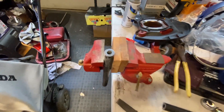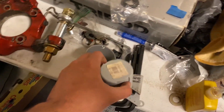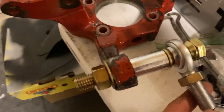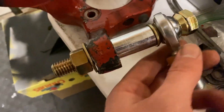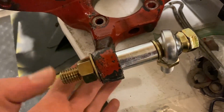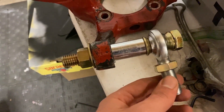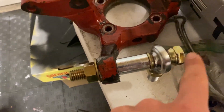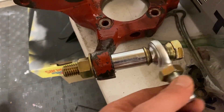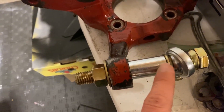I'll get this thing filed down flat and have some tie rod tubes made. Working on this tonight while waiting on parts. This is the knuckle setup - this is the bottom, this is the top. The end link setup is going to be: the 5/8 heim joint, a 5/8 grade eight bolt, offset spacers for more articulation, and a 5/8 steel spacer.